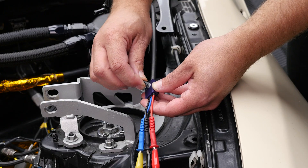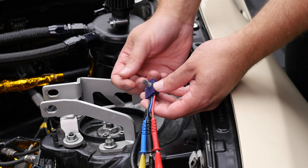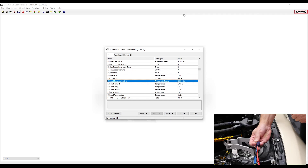So I've got my potentiometer here. I can vary that input voltage to the ECU channel from 0 to 5 volts, and on my laptop I'm monitoring the output channel. What I'm monitoring is actually the output channels seen by the C125 dash — so this is after it's been read by the MoTeC and then transmitted over the CAN bus. If I move our potentiometer value, we can see we are getting a varying pressure reading.